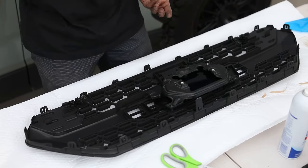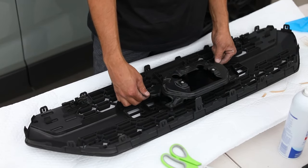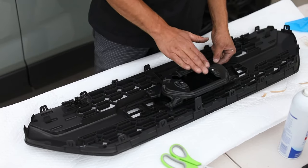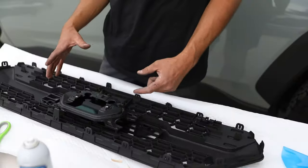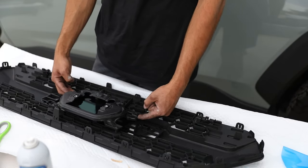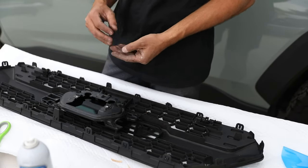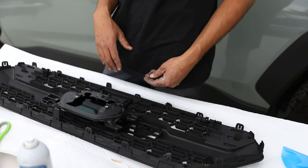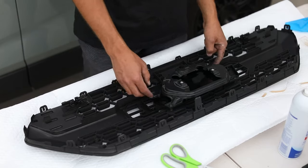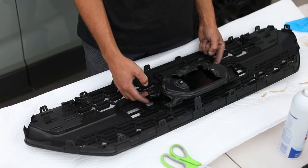On the bottom. Now for the sensor right here, to kind of square it off, I've noticed that you can add a quarter inch spacer. It just depends on your lift and whatnot, to help with the angle of the sensor being placed onto the road. What I'd recommend is maybe adding a small spacer here. That way it orientates itself correctly. It really depends on your lift, the rake, and angle of your vehicle. But on this one, where it has basically the adventure model lift, we're gonna add a small spacer behind the quarter inch one, just to make sure that that sensor is shooting out correctly.